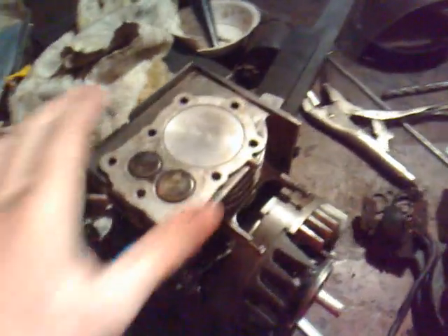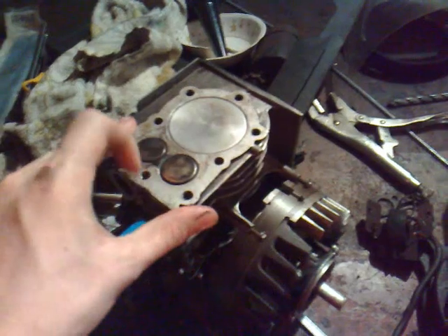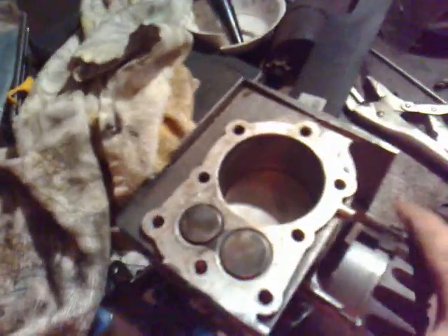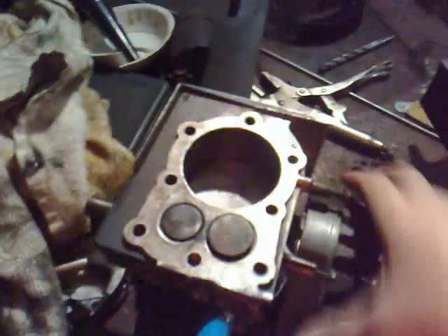Hey guys. I was running it and it just wasn't running as good as it can because the intake valve was actually staying open for a little bit longer. When I was on its fullest downstroke, the intake valve was still open a little bit when it was coming up, so it was in fact pushing it down, stopping a lot of that momentum from coming up.